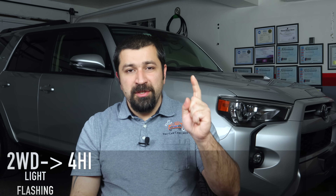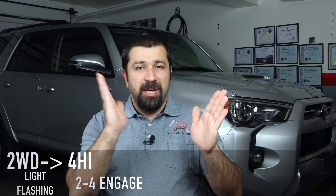These are the basic bare-bone components of the transfer case — we're keeping things simple. Here's what happens when you shift from two-wheel drive to four-wheel drive. Let's talk about the button version first, because the manual shifter happens a lot quicker. So you press the button from two-wheel drive to four-wheel high — high means we're not in low range, not using the planetary for reduction. When you switch to H4 or four-wheel drive high, the first thing that happens is the actuator on the transfer case turns and engages the two-four fork, changing from two-wheel drive to four-wheel drive. Now the front prop shaft is spinning.